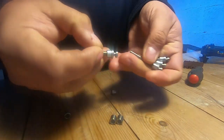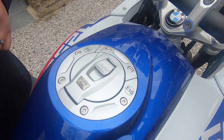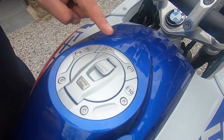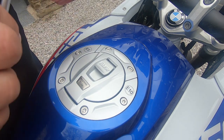There we go — seamless, it's almost as if only moments have passed. So that's all four of those done, with the allen holes facing out at the bottom. Now all I need to do is go and fit those to the bike. The fitting is pretty easy — this is going on a 2020 BMW R1250 GS. It's just these four front Torx spots that need to be removed, and this is a T25, so I'll just take those off.